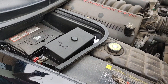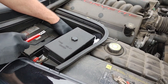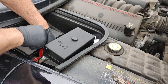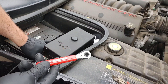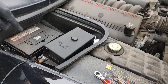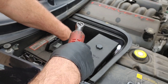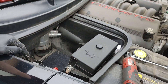Now I'm going to send the wire from the relay into the cabin. To do that, we need to remove the battery. I remove the terminal of the battery — I have this very useful tool specifically made for those kind of batteries, it's a ratchet tool I bought at Canadian Tire, but you'll probably find something like it on Amazon. Now the terminals are off, and I'm going to remove the 13-millimeter bolt to take out the battery.